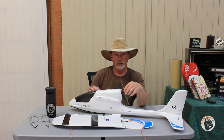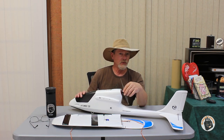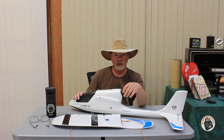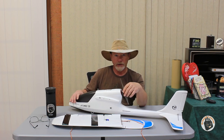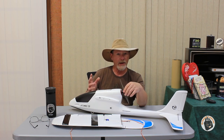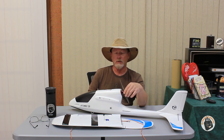And I would run it on a 3S — but you're going to need about 225 to 230 grams on the front of that. Now whether that's a lipo, or like me, a combination of lipo and action cam — whatever you do, you're going to need about 230 grams on the front of this to be able to get the CG on any battery including a 3S.